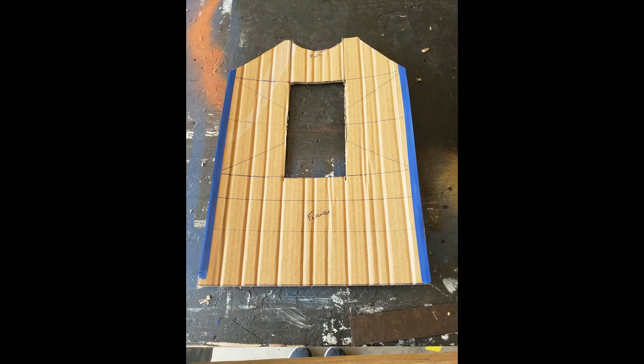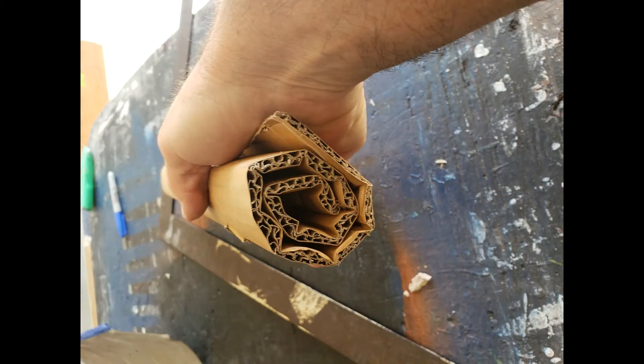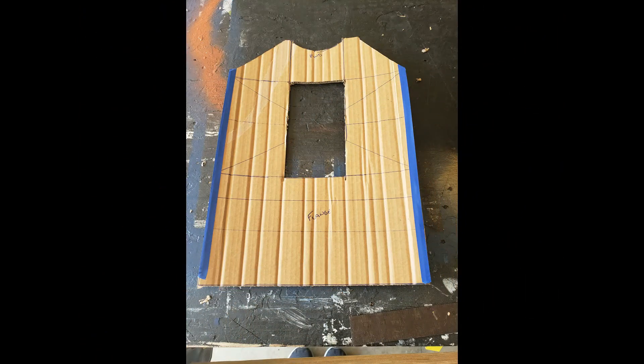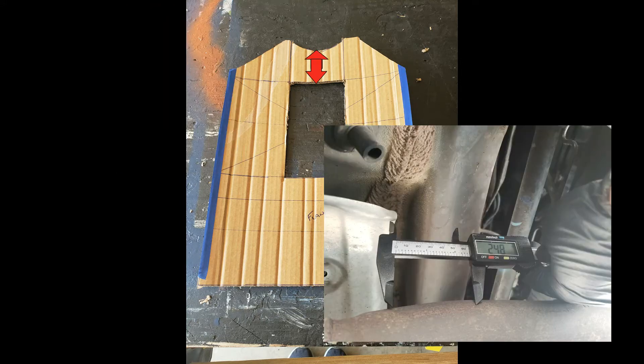The first thing I need to do is create a template that I can trace onto my steel for cutout. I need a piece of cardboard that I can bend. So I take a straight edge, place it on the cardboard and make a series of bends. When I'm finished, I can roll the cardboard up so your template can take a round shape. This distance is the length of the heat shield. On the front, I extended it far enough that it would just barely clear the pipe — that is, after I put the little notch up at the top.